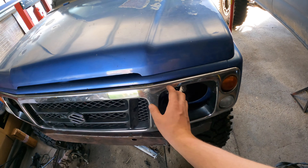Out of the chrome bit, just for looks so it didn't look out of place. I had to keep that section and take it out of here, so the headlight opening is actually smaller. When you sit it over, it covers up that join there — obviously there's a join here but it doesn't cover up the headlight. It's just that this taper isn't as visible on this side. It was the only way I could make it all look right. If I took it out anywhere else it would have thrown body lines out. You do need to cut a little bit out of here to allow it to angle in and a slit out of here to do the same thing to open it up. All down there stays untouched — just tack it all back together and do the same on this side.